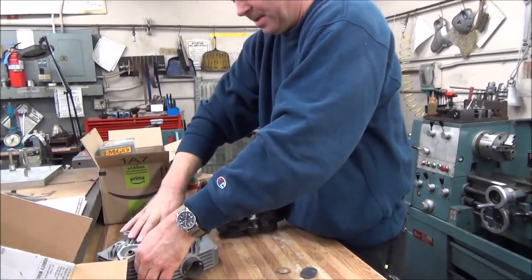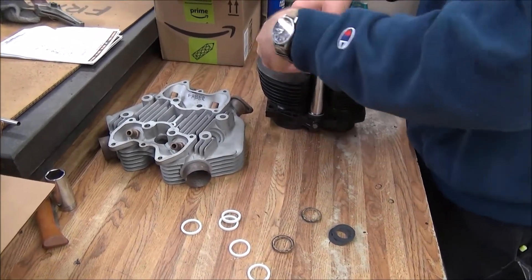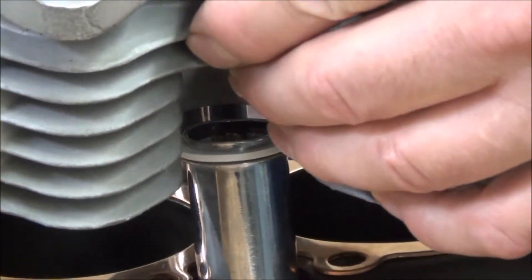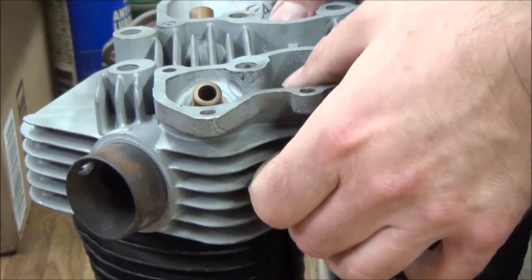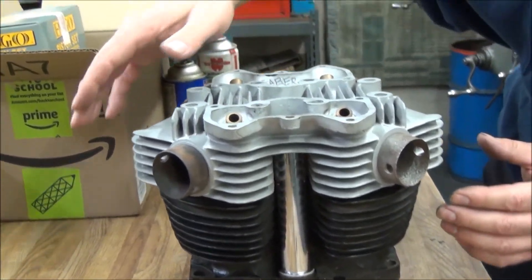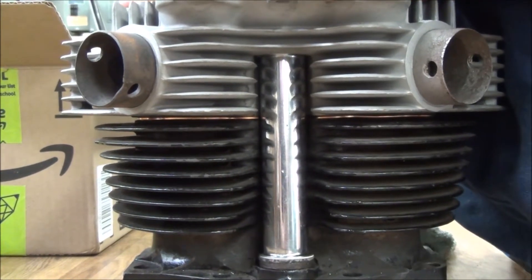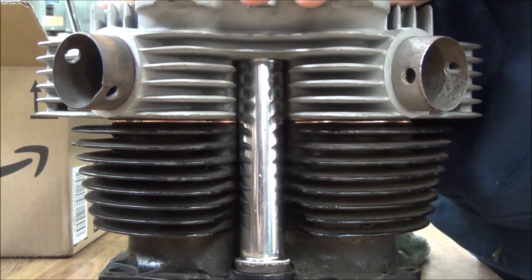Now we're going to put it together with some thinner tube seals — these happen to be all four of the thinnest ones that Triumph offers — and this should get us closer to where we need to be. We'll get into part numbers in a little bit as far as the thicknesses you'd need to order to get the thin ones. What we've got here is a possibility that the head has been surfaced, the cylinder top may have been surfaced, or maybe we have a mix and match situation with guide blocks and the head and various other factors. But now with the four thinnest ones in here, we've got a little bit of rock, and if I push this down, I believe we can get it down just with hand pressure to where the rock is going to go away, which means we're pushing the head down onto the gasket, we've got a reasonable amount of compression on the seals, and by putting the head bolts in and torquing everything down, I don't think we're going to have a leak. I think that's a good installation there.